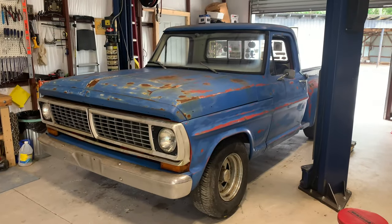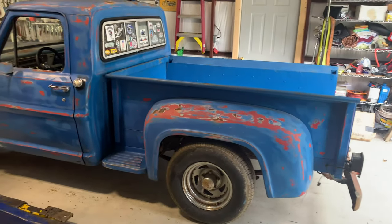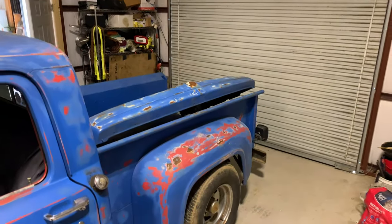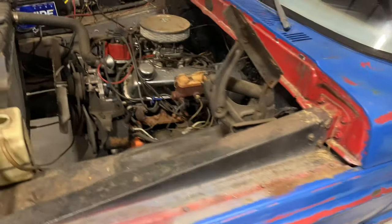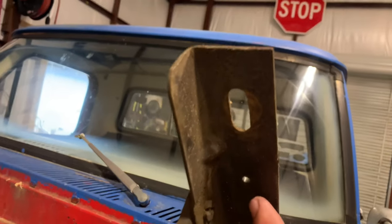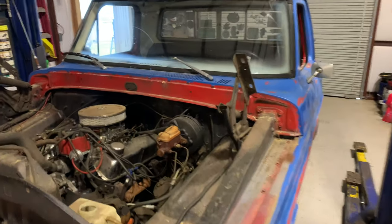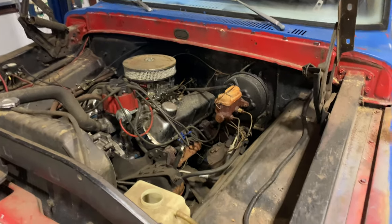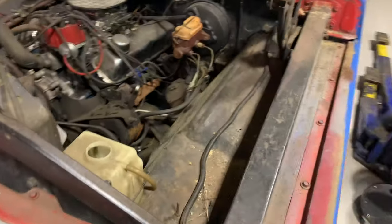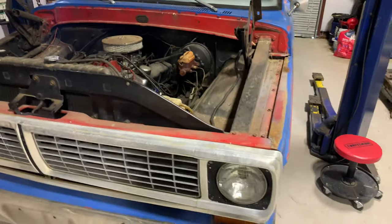This is a production of WGBH. The hood is off — that's our first big step. A little trick to get the hood line back up: run some self-tapping screws through the bracket and into the hood. When you put the hood back on, shoot those two screws back in and bolt it right back up where it was. We're probably going to pressure wash all this and get it cleaner before taking it all the way down.